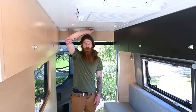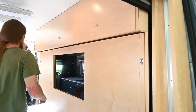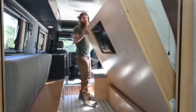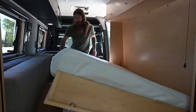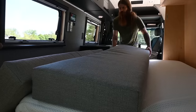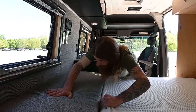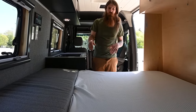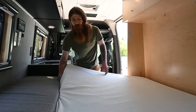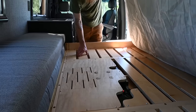Up here the ceilings are six foot three — we have two and a half inches of poly ISO. I'm five foot eleven for reference. Now let me show you the Murphy bed. First, unlock both of these counterclockwise. Fold up the bottom seat of the bed to keep it out of the way. You can pull down here — the bed is on a spring so it doesn't have much weight. This folds down. Both cushions have a taper to them, so as long as the larger side is on the shorter side, both sides will fold down. You have a short queen size bed in the back. The mattress is five and a half inches of memory foam with a cooling foam on top. Everything in here is fiberglass-free with a fire barrier. The housing underneath supports the monitor display, so you have access to all ports including a VGA port for hooking to your computer for video editing or any other purpose.